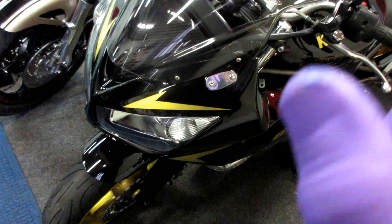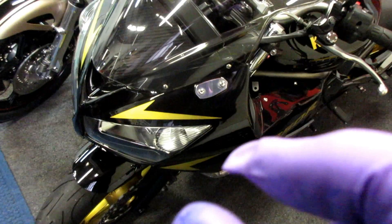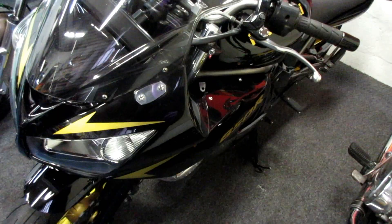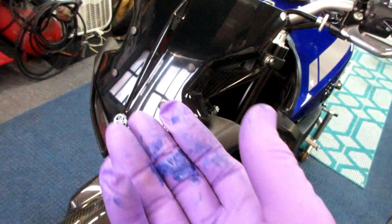Here's a good tip worth sharing: when I did this restoration there were a lot of fairing parts, and you can't really see the screws — they're inside, up under the speedometer. What I did to find out where the screws are: look up the SKU on Partzilla and you can see where any screws are. Sometimes you loosen the screws, can't get the part off, and you don't want to break it. Especially on the Kawasaki, to get the side fairing on there are little tabs that all have to line up, then one screw holds the whole thing in. It's similar with this, and I can picture people getting frustrated trying to get that off because you can't see any screws except the first one. The part has to go in and drop down, line up, and then one screw holds the whole thing. That's kind of how Yamaha does things.